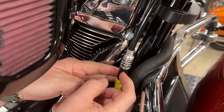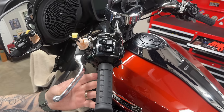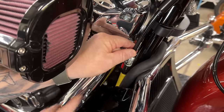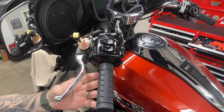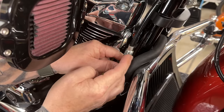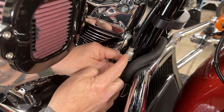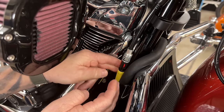I've played with this and you can make some fine adjustment. If I wanted more play in my clutch handle, I can take this and manipulate it — kind of trick it. Pull down just a little bit, then lock this in, and that's going to leave a little more play in the clutch handle, closer off the grip to engage the friction zone. But what I found is you have to keep doing this because it tends to back off pretty quickly. It's just not a good system to properly adjust your clutch lever.